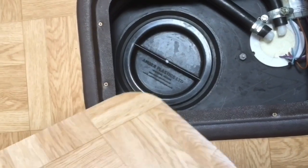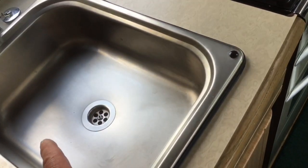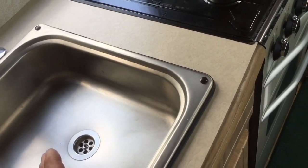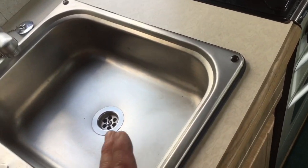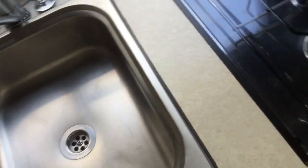This would not be very good for winter. In the other Vista I actually left the water in and used the van in the winter because the water was indoors - there was just one water pipe going under the van from where the water tank was to feed the kitchen sink. I insulated that extra - it was already insulated but I added more - so I was able to use water through the winter. That being outside might be a problem, so we'll see what happens when the winter comes.